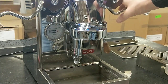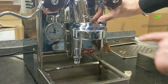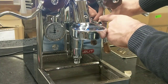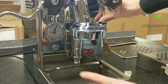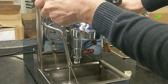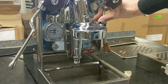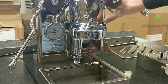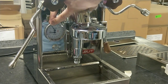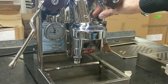I press — in this case I can press the pump. If I push the microswitch for the coffee delivery, the pump starts. And as we can see, we can move the pressure in the steam boiler. This happens when the solenoid valve for the water charge is locked in open position. Look.